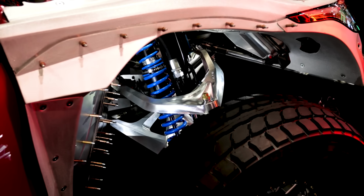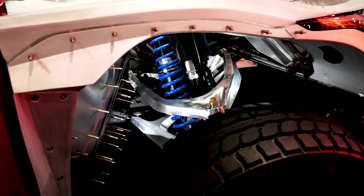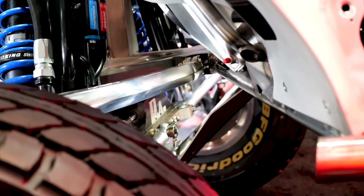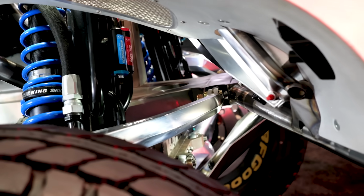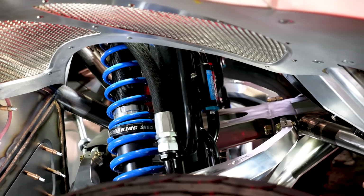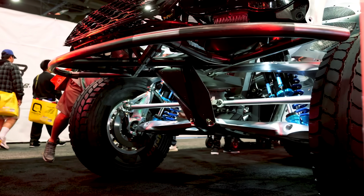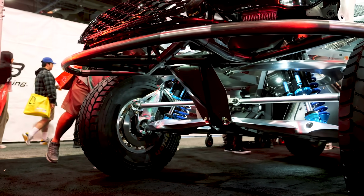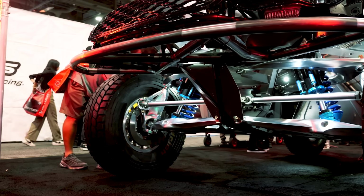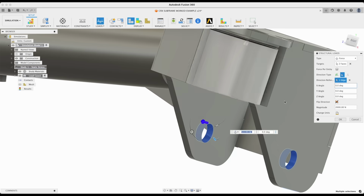We do most of our suspension stuff in CAD. Definitely the front, I designed all the front and that's all billet CNC now. That's all been in CAD. We scanned everything originally and then we cycle it and we verify dimensions or we'll do strength analysis and we'll get all that data. And it's also keeping it very true. Some of this has a little leeway where it's built on a chassis table, but no matter what, when you're welding it, things are going to move. But all the suspension and all the critical swinging parts are all CAD, all scanned, verifying clearance, bump, lock, all the stuff.